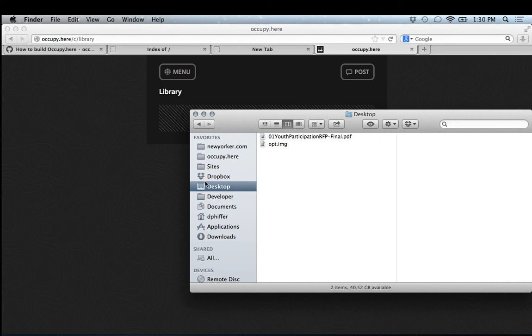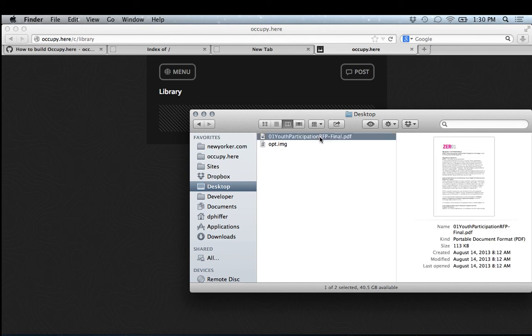So what I'm going to do is shut my router down. I'm just going to remove power. And then I'm going to remove the USB. You should always take the USB out when the power's off. It's kind of good practice. And I'm just going to transfer this into a folder called import. And that kind of is enough to get it to work.